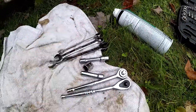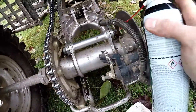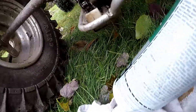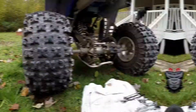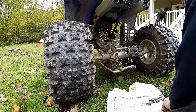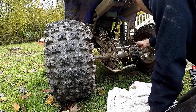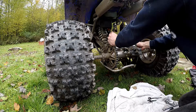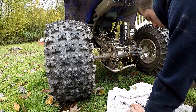All these points here — because that's what's gonna slide — you want to do your adjustment screws first, then your nut down there, and then you can do the joints. So I'm gonna ratchet this off and tighten these up for you. You've got your 17 through here, then you can reach through and grab your 17 wrench to loosen it with a ratchet. I already loosened these so they're loose. And then you've got your adjustment screws — this is a 12, so take a 12 wrench like this.